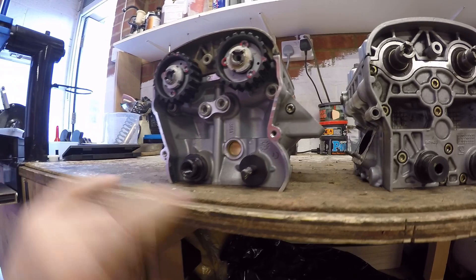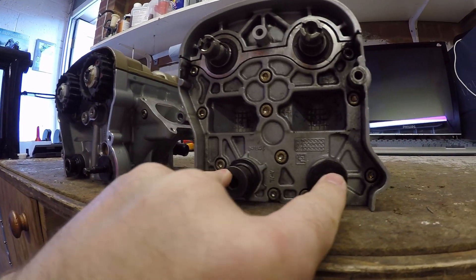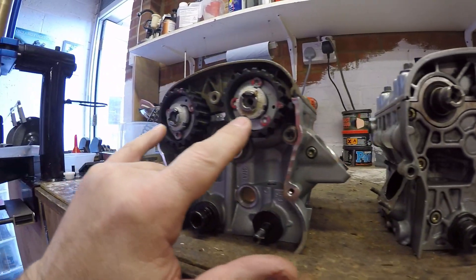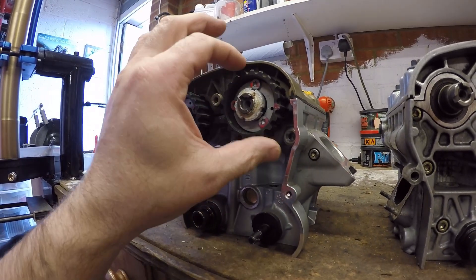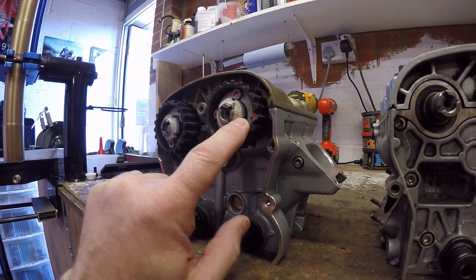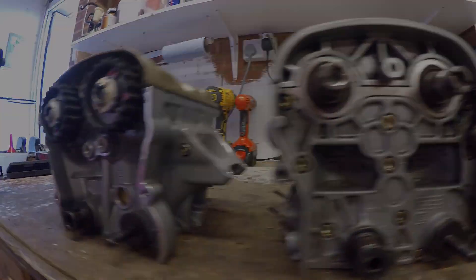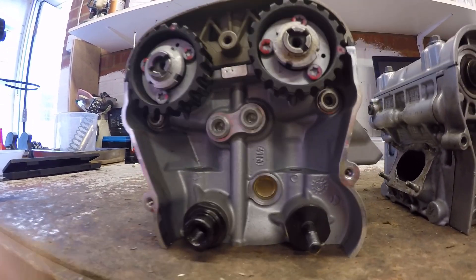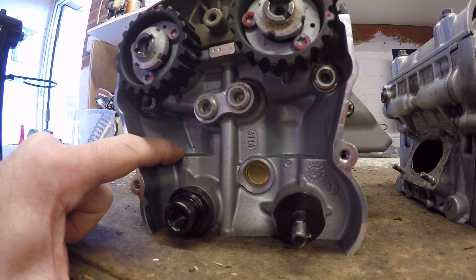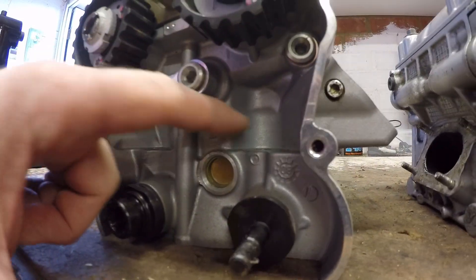Spinning round onto the cam side — both engines use exactly the same mounting mechanism for the mobile and fixed pulleys, so that's a crossover between the two. The cam holding technology is the same: an adjustable cam wheel held in by a nut. In terms of securing the head to the engine, it's the same philosophy for both, and both have cast faces — the casting process is notably better on the later engine.